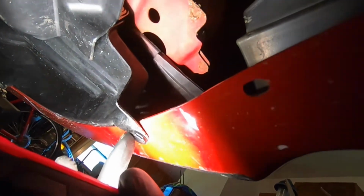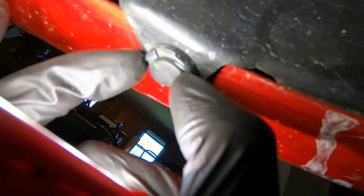One thing that we do still need to do is go under the car and take off this underbody panel. We'll have a whole bunch of these pop tab rivet things that we'll need to take off, and those go pretty much around the whole front of the vehicle. Those are pretty easy. You just stick a screwdriver underneath that little tab, pop that up, and then this thing should slide out. If you break a few, it's not a huge deal. These things are pretty cheap. I'll put a link in the description to some extras if you need them.